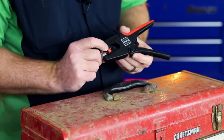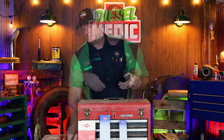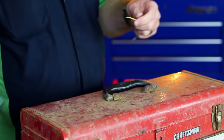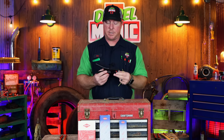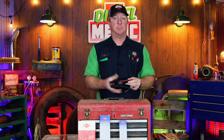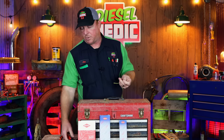What's cool about these is you can adjust the depth of how deep you want it to strip your wire by pinching each side of this red stopper and pulling it up to adjust. You push the wire in to hit the stopper — which is your depth gauge — and boom, it's done. These things strip wire really quick. I actually like the front-load design because if you've worked on many trailers, the wiring's always close, especially in the rub rails or drip rails at the top. You can get in there, strip the wire, and solder a piece onto it without a lot more work. I know they're pretty expensive, but when you look at how much time you'll save doing wiring jobs — plus that depth gauge making everything uniform — it's going to make solder jobs a whole lot quicker.